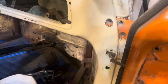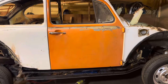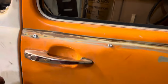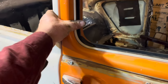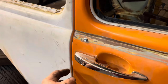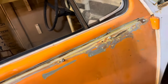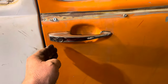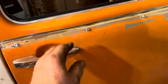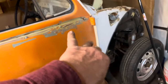It fits in the hole — that's going to be a bonus. I put a door on just to kind of fit things and see how everything is working out. Our lines are pretty good, it's slightly gappy here. The problem is I can't move the door back any farther because the striker will rub on the other striker. However, the gap up front isn't the way I really want it. I might need to examine this more closely and see if I can't move the striker in — there might be a shim underneath there — and that way I can move the door back.